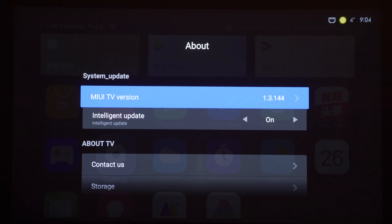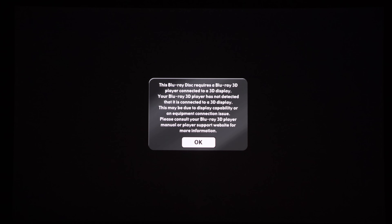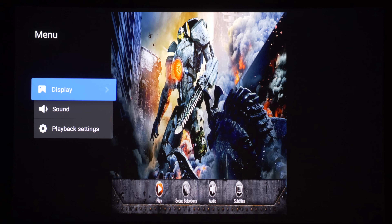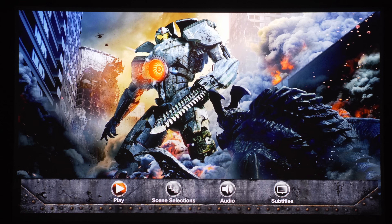HDR on projectors is tricky at the best of times, and the Xiaomi Mi Jia 1080p projector just doesn't do a good job, especially with high-nit content — exhibiting significant white clipping and posterized discoloration around bright highlights in a scene from Batman V Superman, which was mastered to 4000 nits. The lowest input lag can be obtained in monitor mode, which still exceeded 80ms, likely putting off most gamers. We couldn't get 3D working on our review sample with firmware version 1.3.144. The projector isn't returning a 3D-capable EDID to Blu-ray players, so an error message would appear. Even when we managed to force 3D output from our Oppo 203 player, the projector only succeeded in flattening 3D to 2D, so we weren't getting any stereoscopic effect.